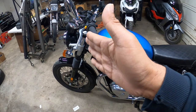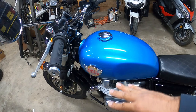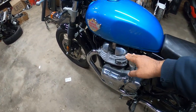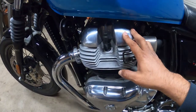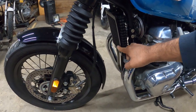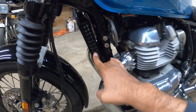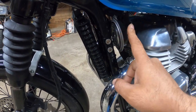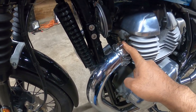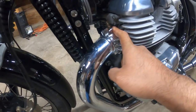Working one step back — right here is the gas tank. If we go down, we have our oil cooler with the grill, a little rock chip grill. Working over to the right, we have the two horns, left and right. We have our exhaust — they're identical on the left and right with the O2 sensors right at the base of the head. Very, very important to remember that.